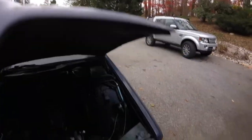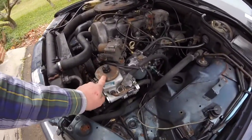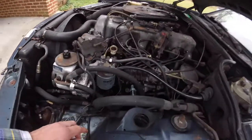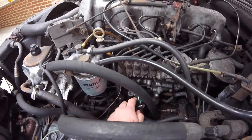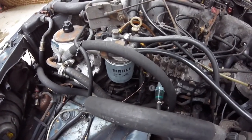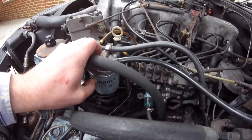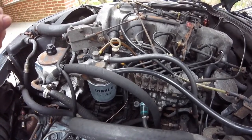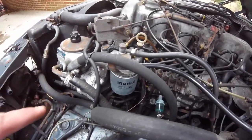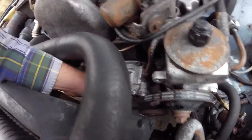Typical maintenance stuff — all filters and belts, oil changes and stuff like that. I've flushed the power steering pump. Two new filters here: your initial fuel filter, and then your secondary fuel filter before it goes into the injection pump. I've replaced those filters. New belts. I've driven about a couple hundred miles now, and you can see they are loose again. So now I've got to tighten them up. Belts will stretch, so it'll be time to re-tighten them.